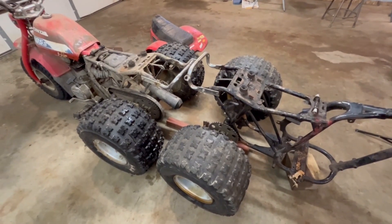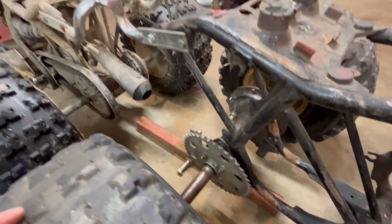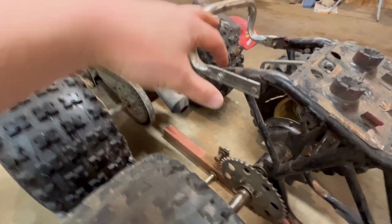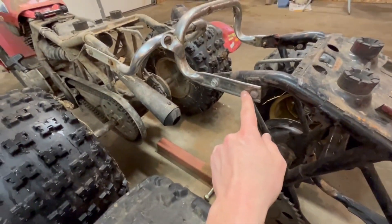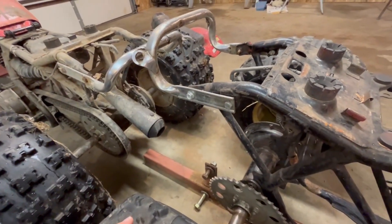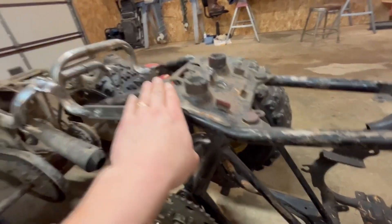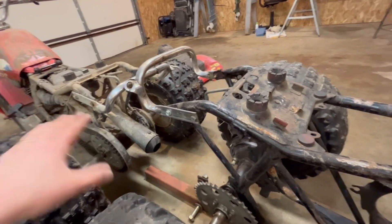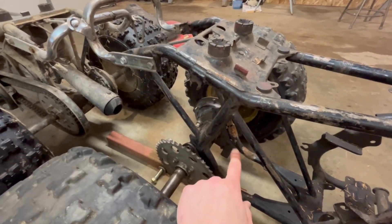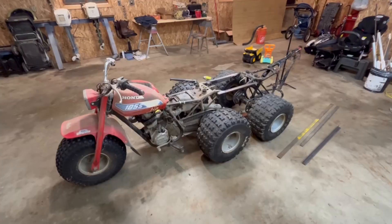So here's one of the ideas I've been thinking of. The axle fits in here either way - it's pretty simple, just two bolts. You look at where this bolts up and that bolts up, it's the same distance apart, it's strong. I can run something from here to there and it will be strong, then figure out something down below. I might just cut this frame off right here - put like a rack back here, kind of like a Polaris six-wheeler - that might work without really having to do too much.